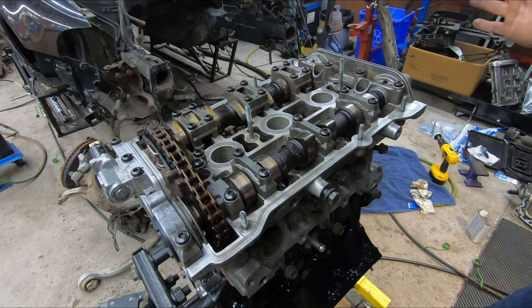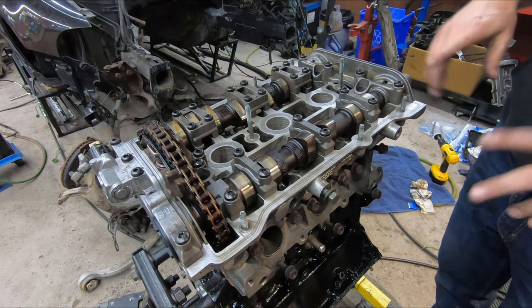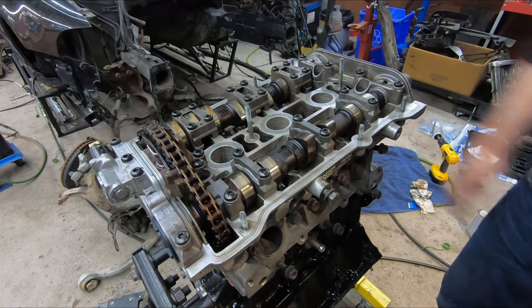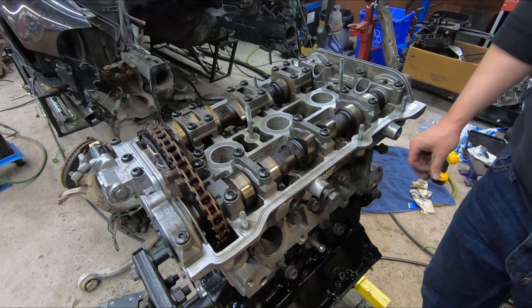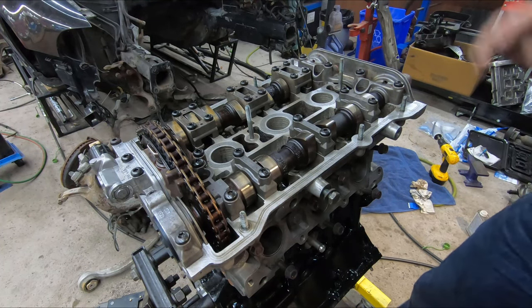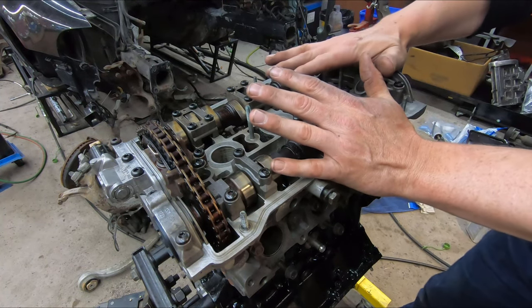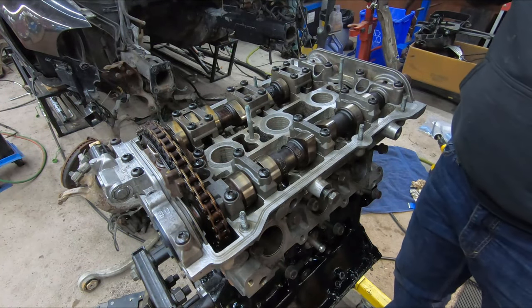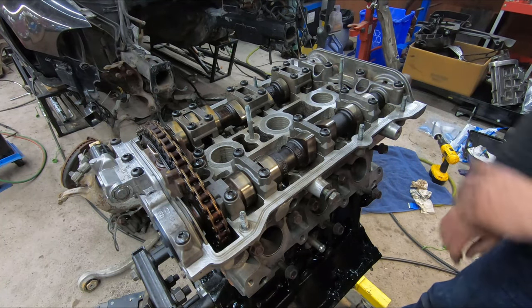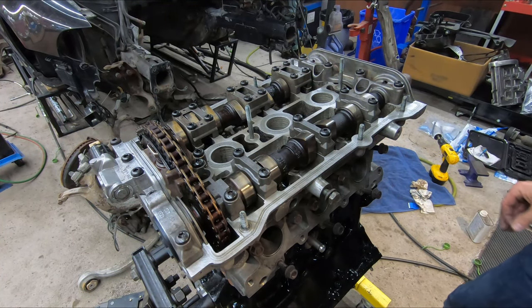From here I'm going to put my other cylinder head on, and then we can start putting the Excess Power Stage 3 turbo kit on this motor — the aftermarket Excess Power manifolds, turbos, inlet piping, and various other stuff including the ECU and injectors. The ECU tune will need some adjustment because I'm using 2.8 heads and the kit is intended for a motor with 2.7 heads. Sign up for updates if you want to see more of this motor as it comes together. I think I'm going to leave you there — thanks for watching, guys, we'll see you next time.